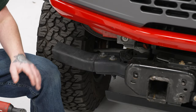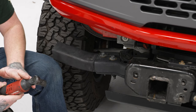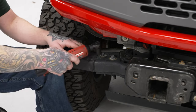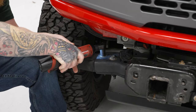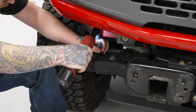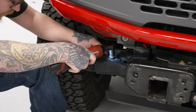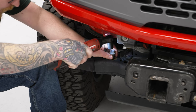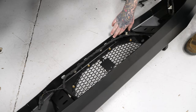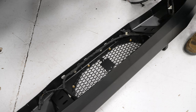Because of the taper of this bumper, you will be seeing your crash bars, so we're gonna go ahead and remove those now. We'll grab our 15mm socket on our ratchet, pop off the two bolts, pull them out, and do the same thing for the other side. Your kit also comes with some stick-on zip tie mounts and zip ties to help clean up your harness — a very convenient option that comes with the kit.